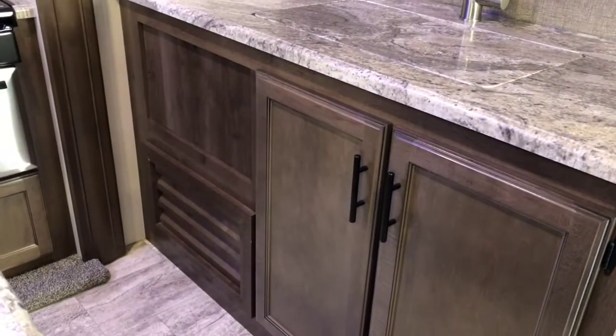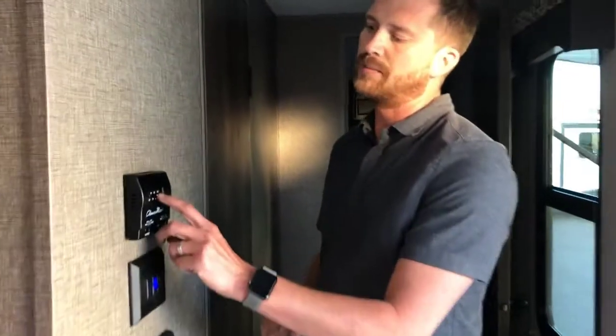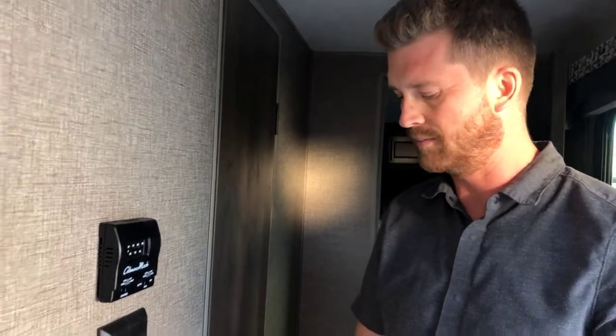Just like so. So now if we wait a few seconds, we would have warm air blowing through our vents. Once the system comes up to temperature, or you shut it off, the same thing happens only in reverse. The burner for the furnace has gone out immediately, but the fan's going to just run for another 30 seconds, up to a minute, just to go through its cycle.